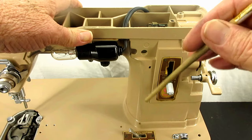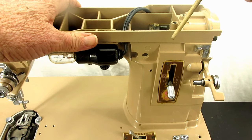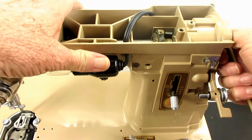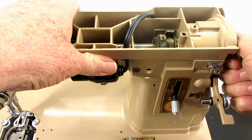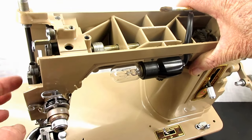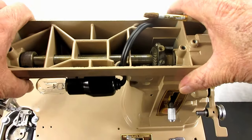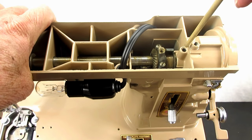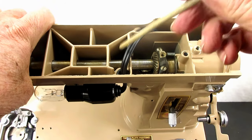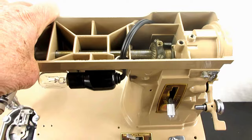And those can trap water, you know. And the washing and everything that we did flushes out the oil. And those locations I just gave you for those bushings, 2, 4, 6 plus this one, are usually why your machine will freeze up. So even though the take-up lever over on this end has many oil locations, and the bottom we can look at, those six on a machine like this are the more critical ones that we want to be sure are dry. So I'm going to blow the whole machine, but I'm going to spend some extra time on those oil ports. Okay.